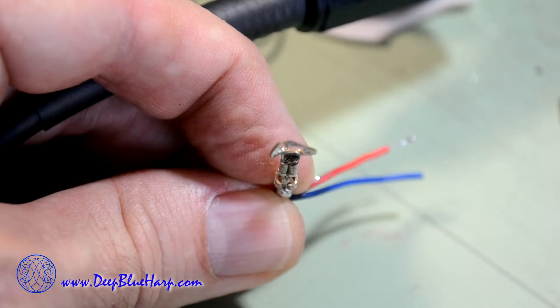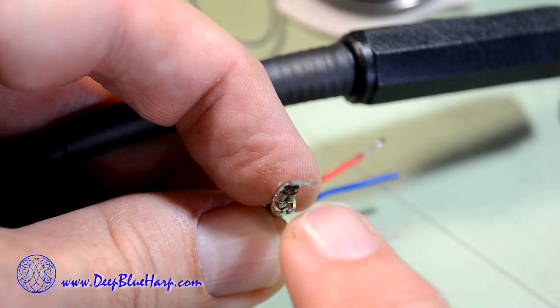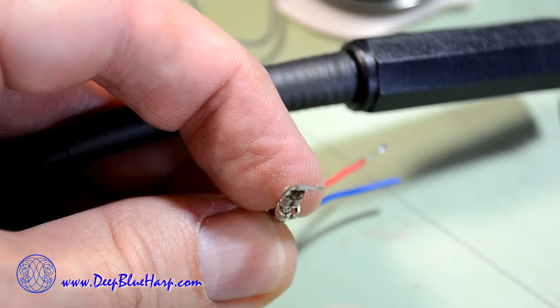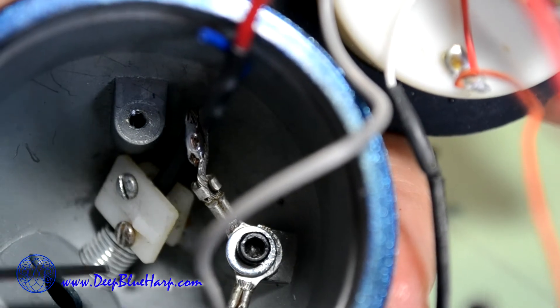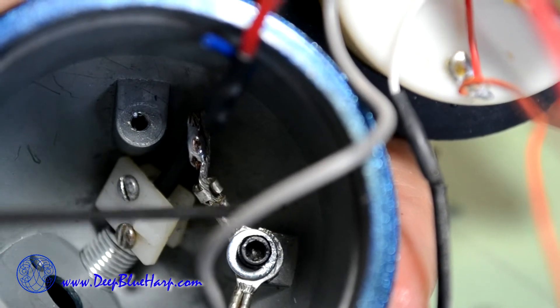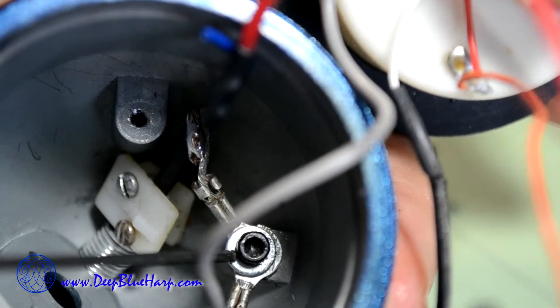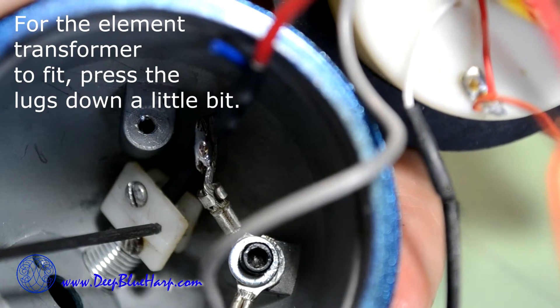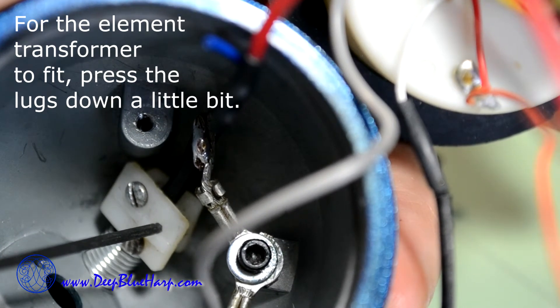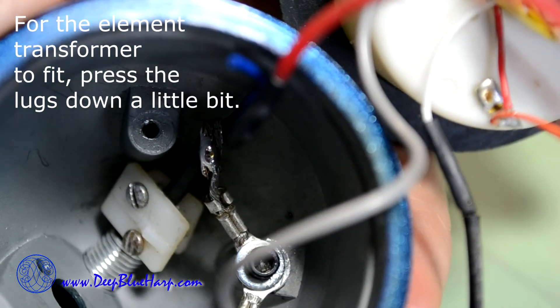Next, once you get the lug on the ground wire, give it a slight bend so it goes up through the body. The ground wire coming up out of the cable is on the lug. The gray wire which goes to the element is also on a lug and grounded. I put the original strain relief back in again — this thing should be tight and ready to go. I'll show you the final product in just a moment.